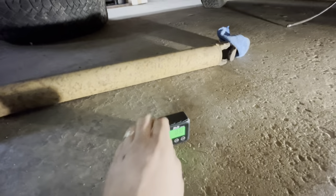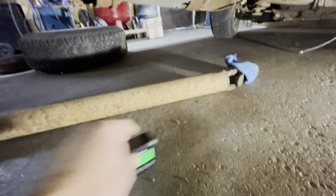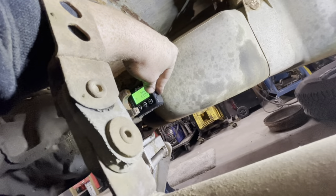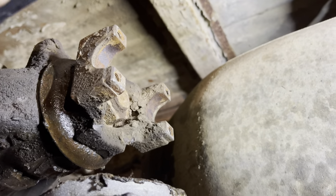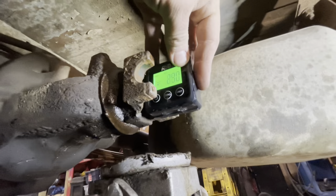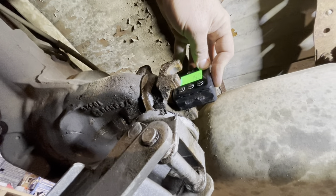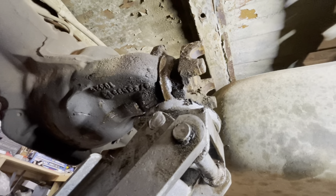Before you burn it in, you want to double-check your angles. The concrete floor probably isn't your best way to set zero. Once I tighten it down you can see it's now at the wrong degree, so we'll have to loosen it off and reset it. Once you verify that your pinion angle is good - all right, we're at our 1.3 degrees, opposite same angle. Now we can go ahead and tack our spring perch plates, unbolt it and weld them in, and tighten everything up.